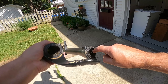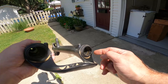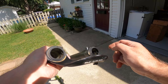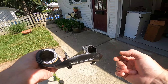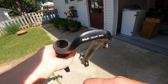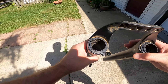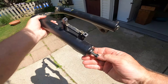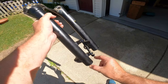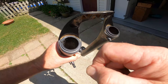I forgot to take off the brake cable holder, so let me take that off and we'll come right back. I took off the cable holder, and as you can see, these are the lowers. What we're most interested in is how mucky it is down in here as well as the ring, because that's what really binds up the fork quite a bit.